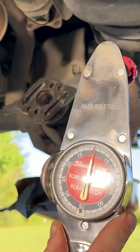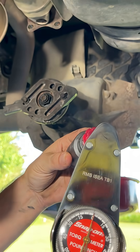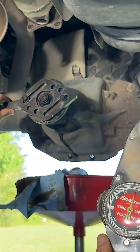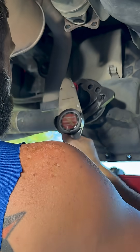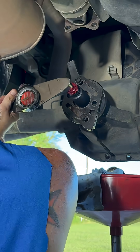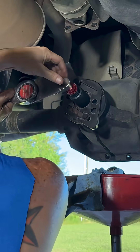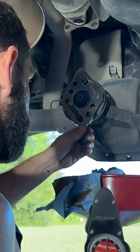This is a rotational torque wrench — this is a Snap-on, you can find them at your local hardware store. Make sure you don't use the clicker style, because this is rotational torque, so it's measured by how much it takes to turn the bearings and the yoke. Looks like about 22 to 23, which mesh confirmed we're right in spec. This is anywhere from 22 to 23.